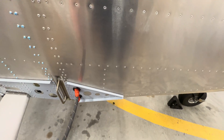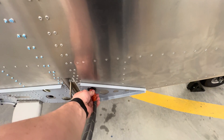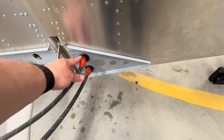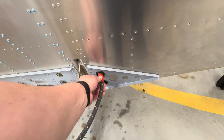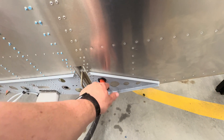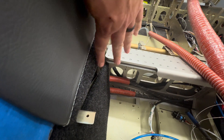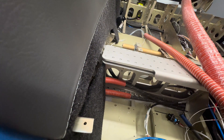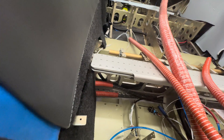Fuel lines — I probably only need this much, but I went ahead and ran them. I put some extra fire sleeve on, and the fire sleeve mostly fills this hole here. It's also some chafe protection. This is the Sling-provided fire sleeve with some silicone fusion tape to keep it on there, and I have a stainless steel zip tie underneath as well. I extended it in there because I was worried about chafing where the side panel is — probably fine, but I'm a little overly protective.